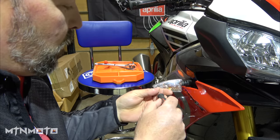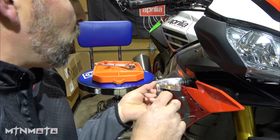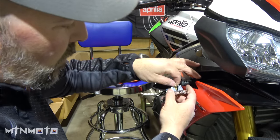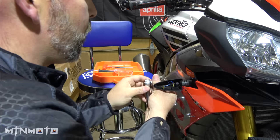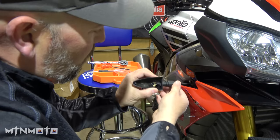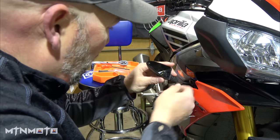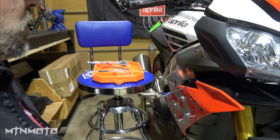In the instructions they say to pull out this 4mm first, but I'm going to take these apart and undo the wiring first. Pull out that little number zero, pull off the lens, get the wire out. You've got two wires in here — a dark blue and a sky blue. We need those off, and there goes the light. Remove the 4mm, feed the wires back through. That's why I figured doing this second would make it a little bit easier. Just like that — that one's gone.